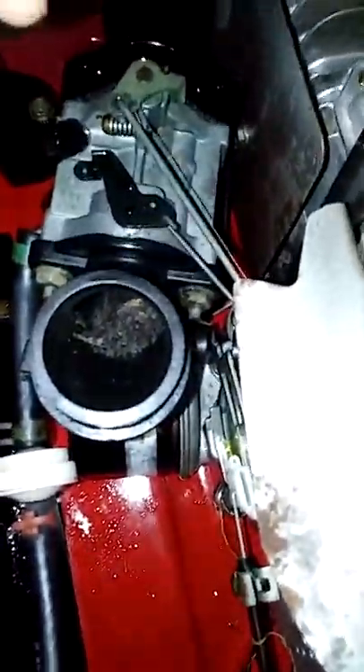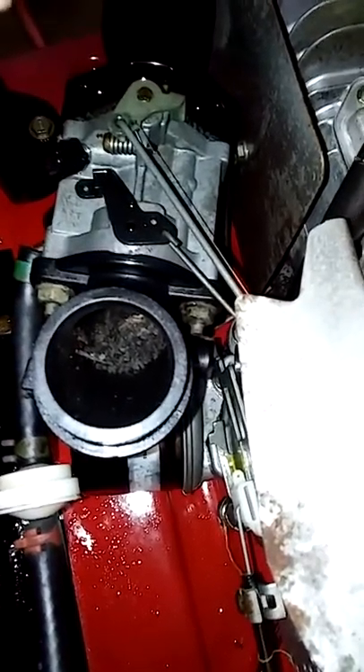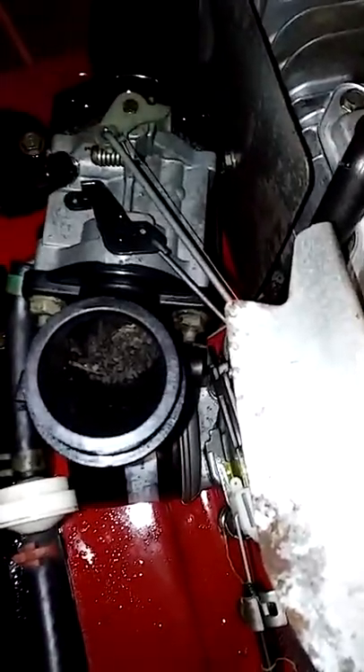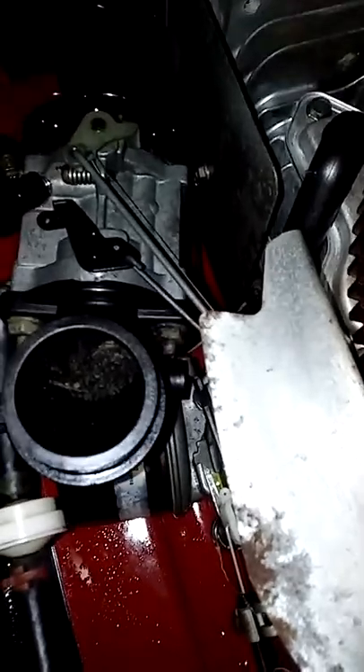I got it in non-running condition, period. I'm going to have to pull the carb on it, because they had the air cleaner filter out, and debris and everything just fell down in there. I stuffed a rag in here to keep blowing it off in there when I washed it, and all this is penetrating oil. I sprayed it over everything so I can pull it off real easy, along with here and down here on the starter.